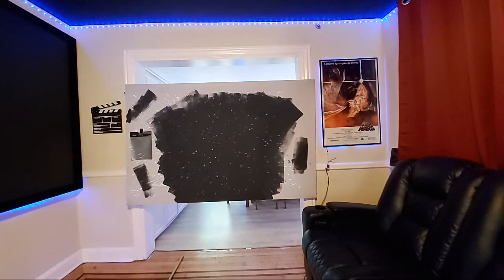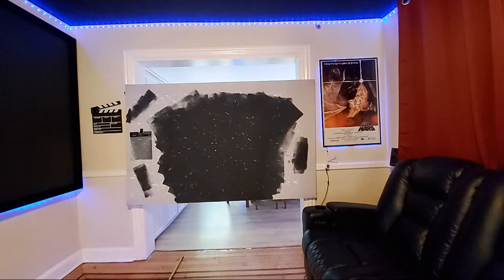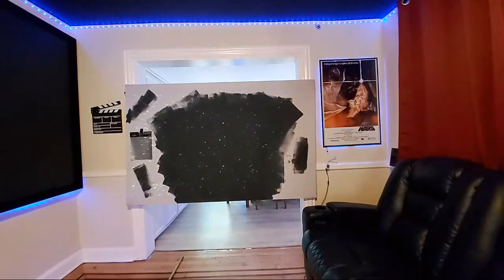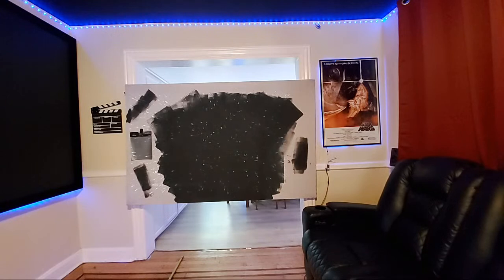My projector has a 2,000, apparently 2,000 to 3,000 to 1 contrast. I told somebody, look, you can have a projector with a 1,000,000 to 1 contrast level, right? And you can show that on a white screen. I can take a projector that has a 200 to 1 contrast and I'll produce a darker black level than your projector at 1,000,000 on a gray screen. Doesn't make a difference how high your contrast level is on your projector. You can't pull a 100% black level. It's the equivalent of trying to go in your backyard and squeeze water out of a stone. It's not going to happen. That's like someone asking, can a black screen produce a white level as high as a white screen? Virtually impossible. Not going to happen.